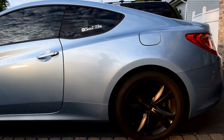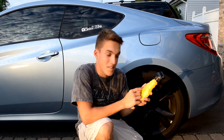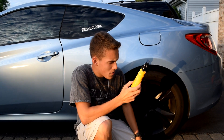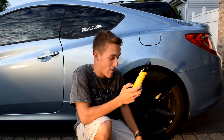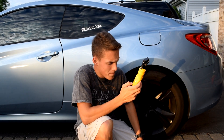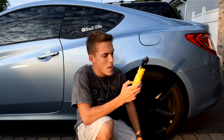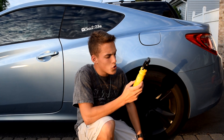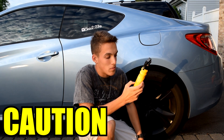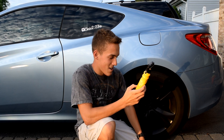All right, so the directions: clean and thoroughly dry surfaces before treating. Apply at temperatures above 40 degrees. Point the nozzle away from the face. Apply Rain-X to a small folded dry cloth and wipe onto exterior glass using a firm circular overlapping motion. Allow it to dry until a slight haze appears, then reapply Rain-X to ensure complete and uniform coverage. Remove final haze with a dry cloth or by sprinkling with water and wiping with a paper towel until crystal clear. Store and transport in a closed upright position. Caution: contains denatured alcohol — keep away from heat, sparks, flames, and ignition sources.